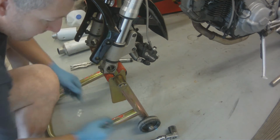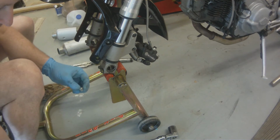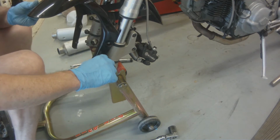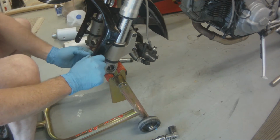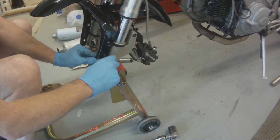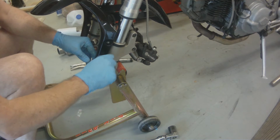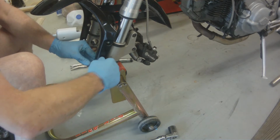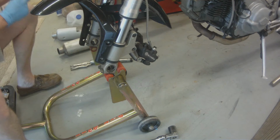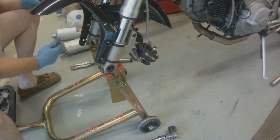And you don't have to be a gorilla when you're tightening down these screws. Once the Loctite hardens, it'll hold these screws into place. The last thing you want to do is over tighten these screws and risk fracturing the plastic. That plastic's unforgiving. The vibration from the road, the vibration from the motorcycle. The last thing you want to do is damage the fender, because maybe you like the black plastic fender and you don't want to buy carbon fiber.